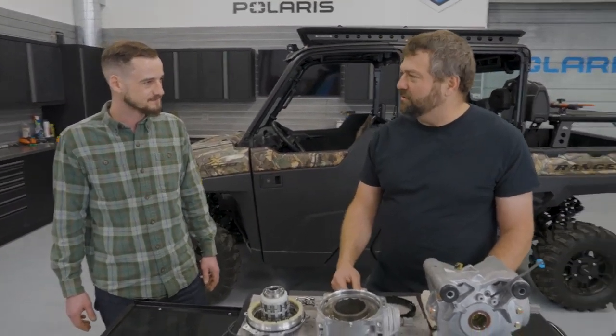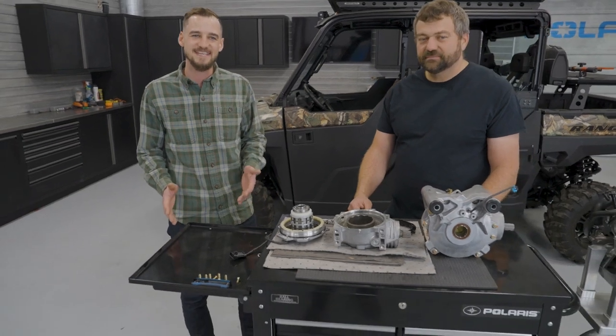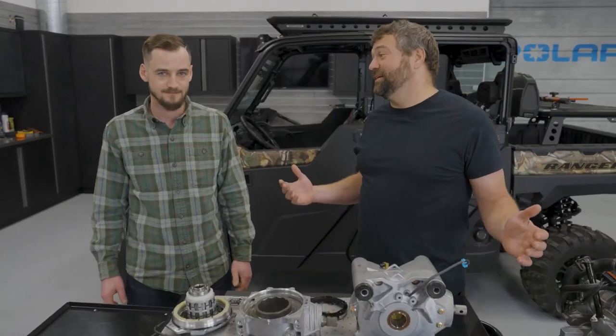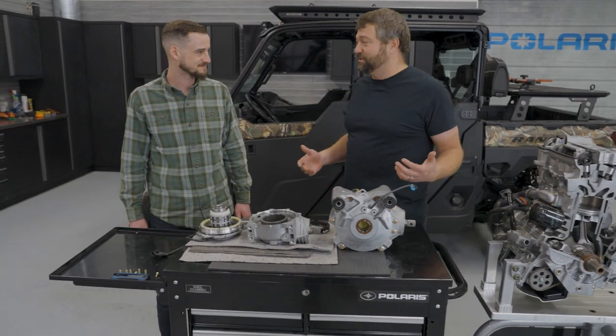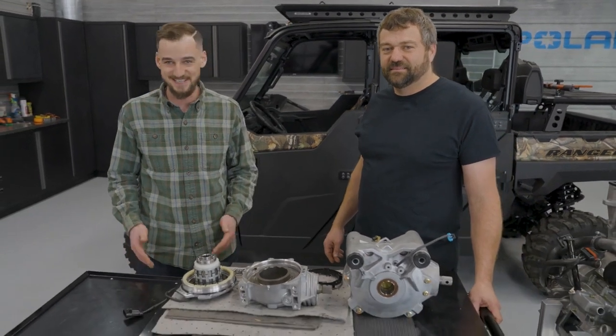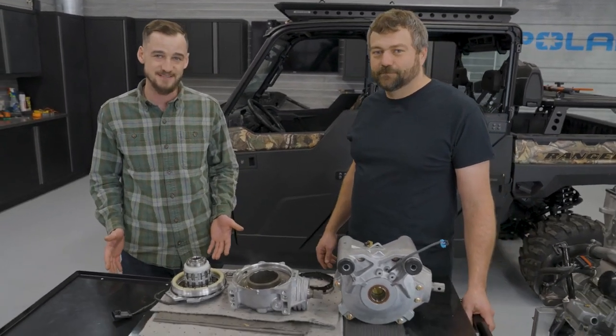Those are really the basics and that's what we wanted you guys to take away from this video — you don't have to switch between modes while you're out trail riding. You can put that vehicle in all-wheel drive, and this system, while pretty simple, is ingenious. It can adjust to what's needed and provide more torque to the front end when it's needed, but it's not going to make your steering difficult like a lot of other four-wheel drive vehicles — and that's the real benefit of a Polaris system. We just covered a ton of content on Ranger driveline, how transmissions work, how front drives work. Give us a comment, let us know what you thought of the video. Like it if you liked it, leave us a comment and tell us why if you didn't, and give us some recommendations on more content you'd like to see in the future. Thanks for watching.